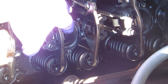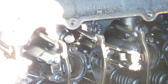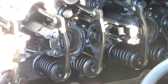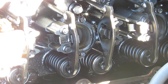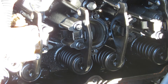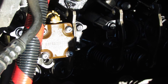Here's the electrical connection of the glow plug — that little silver dot. It takes a 10-millimeter deep-well socket; I used a three-eighths drive that worked fine, though I've seen guys use a quarter-inch. Get it out of there, then put them back in once the injectors are in after you've turned the engine over to blow out any fluid that might have built up. All right, I'm going to go ahead and put the rest of the injectors in — same process for all seven. That one went in very easily, no issue.